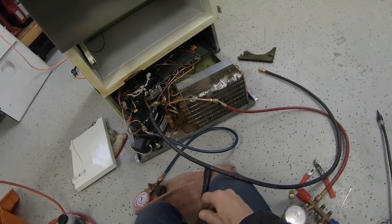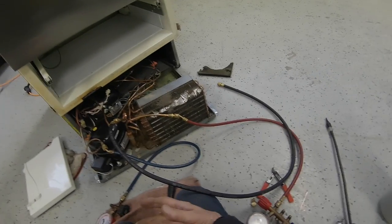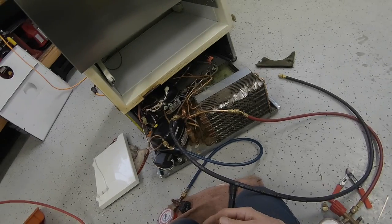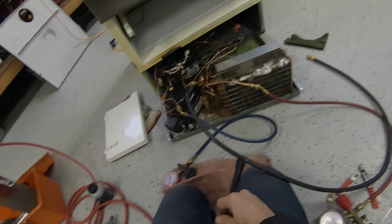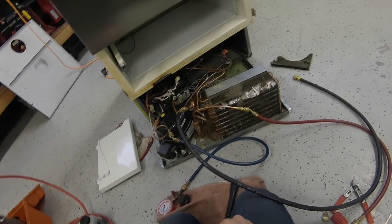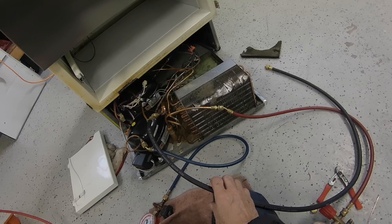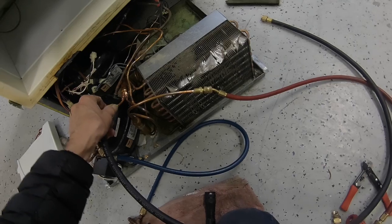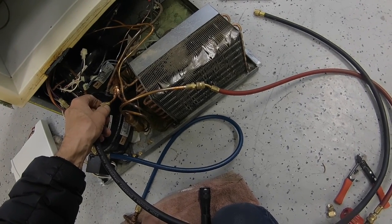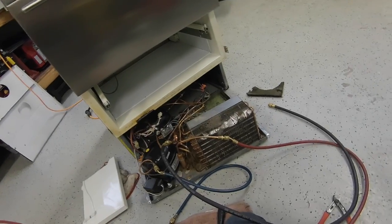After that, you recharge it. In most of my videos when I work on sealed systems, I've just failed to mention that I always do a sweep charge before charging the system up, and I had some subscribers question my methods. You always do a sweep charge because when you disconnect the hose from your sealed system — even if you're in a deep vacuum — once you loosen the hose and that Schrader port is open, it could suck in a little bit of air. This is how it's done.